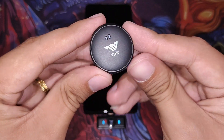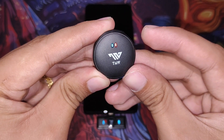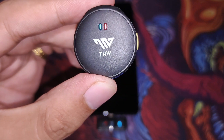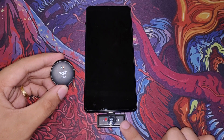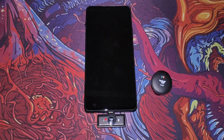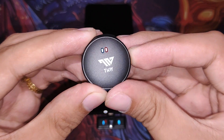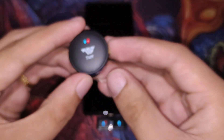To connect, long-press again to turn on the mic. Once connected, the blue light on the mic stays solid, and the receiver light also stays on — that means the two are connected. For the second mic, it's the same process: long-press again, and you'll see the blue light on both the mic and receiver.